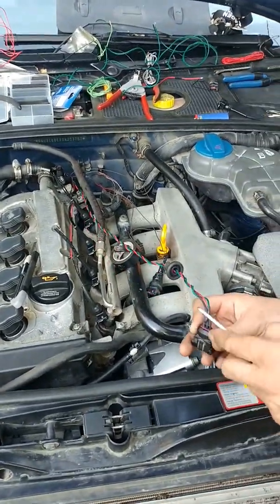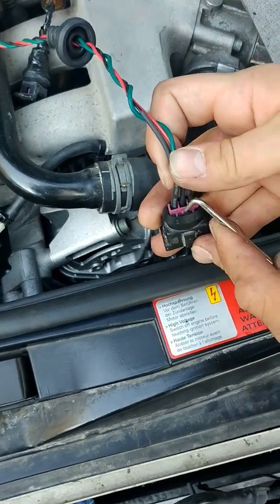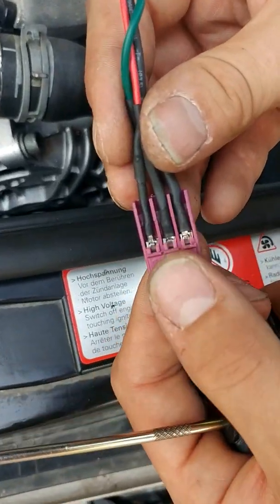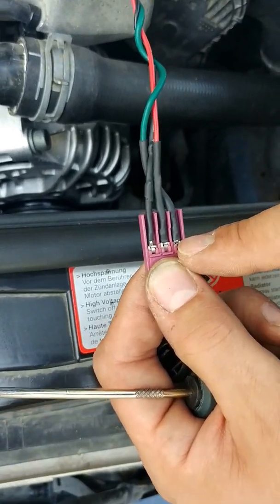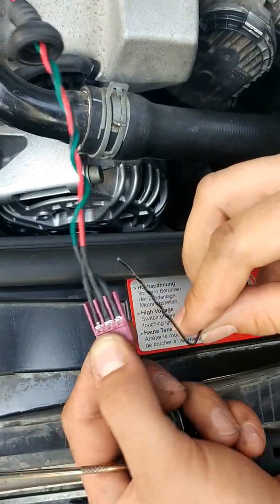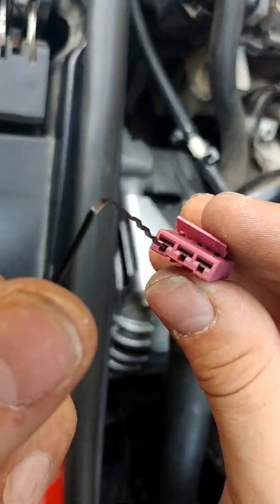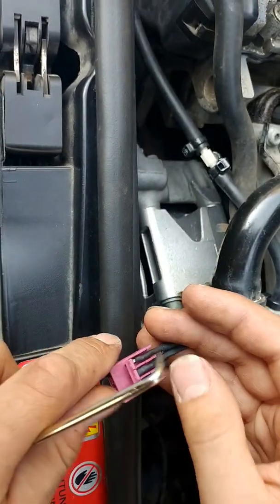This little tab here — you just take a little 90-degree pick, pull it out like this, and it comes right out. Turn it around — see these tabs. I don't have the brand new connectors so I just reused these, and it still works fine. What I did is I took a bobby pin, put it in the front of the connector right here, push it as far as you can, pry down on it, and the wire will pull right out.